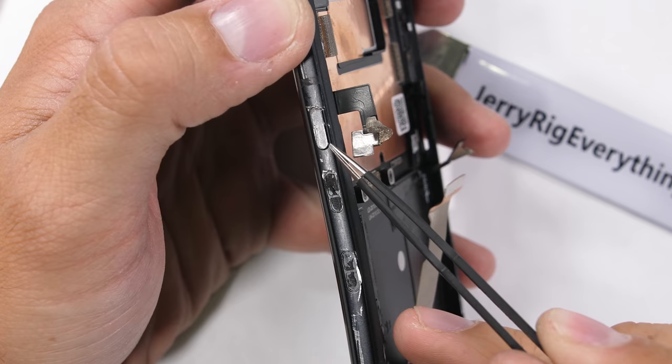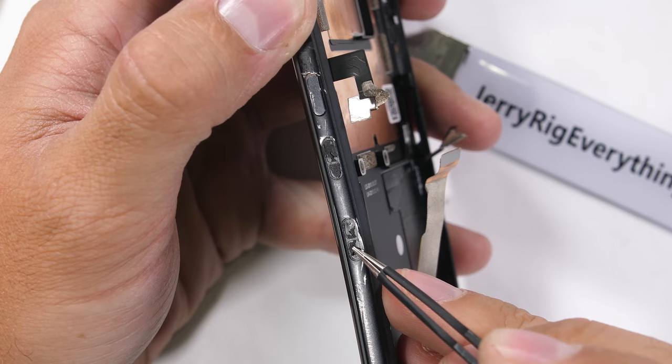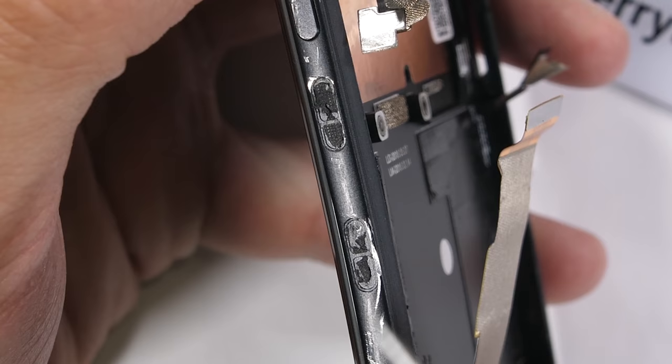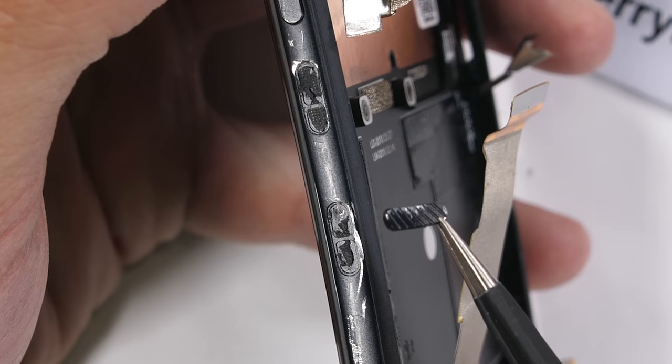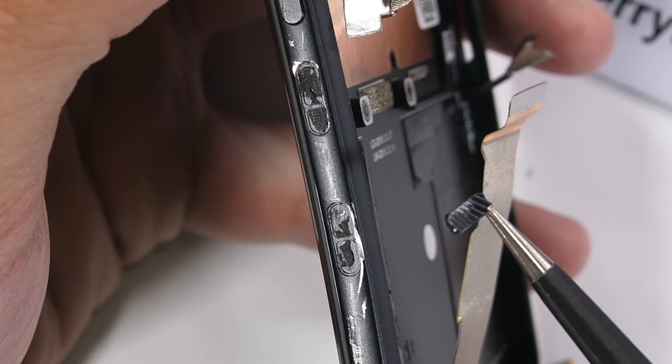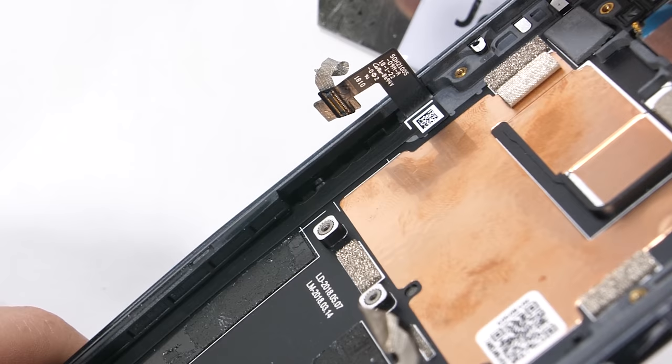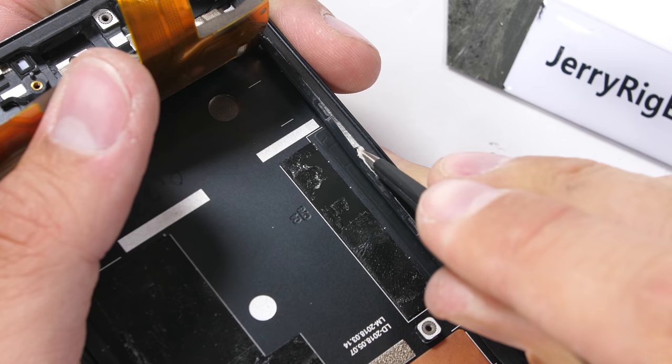Now let's talk about one of the biggest flaws in HTC's design: the pressure-sensitive buttons and squeezable sides. The buttons aren't actually buttons — they are little unmoving protrusions in the phone frame that can come off if persuaded. And once a button is off, its function is unusable on the phone, unless you carry around a spare pair of tweezers like I showed at the beginning of this video. The pressure-sensitive ribbons are the electronic components that capture each short and long squeeze of your hand through that soft aluminum.